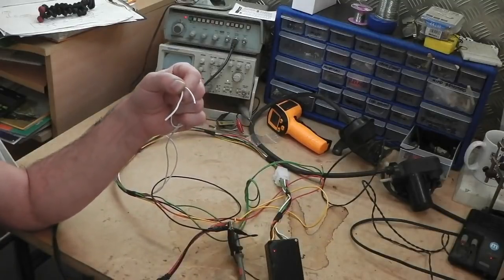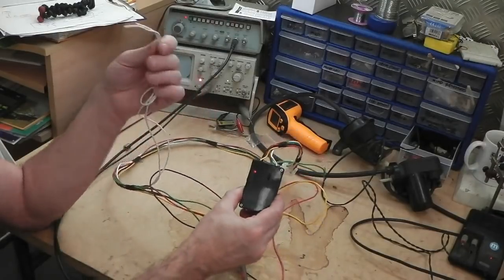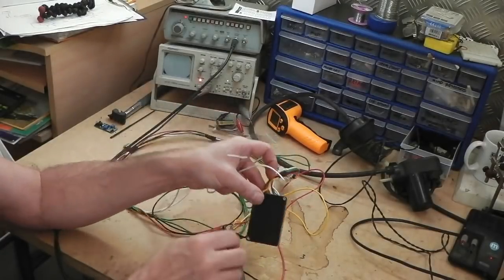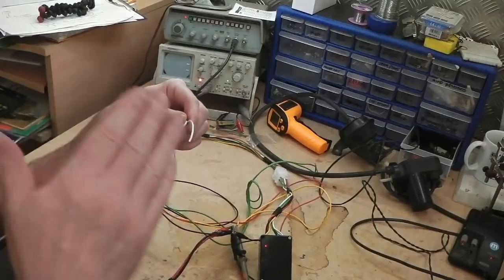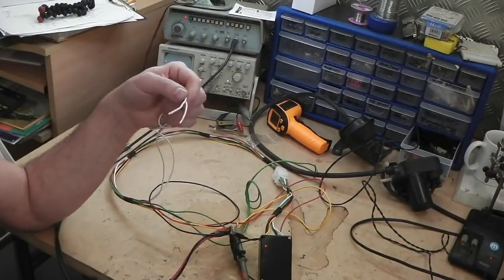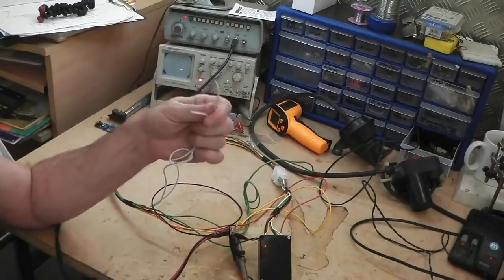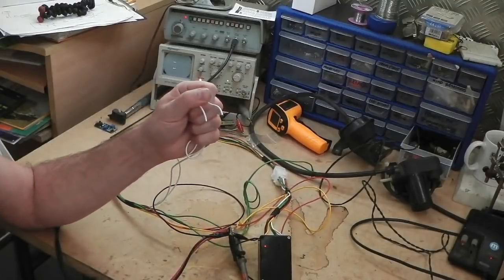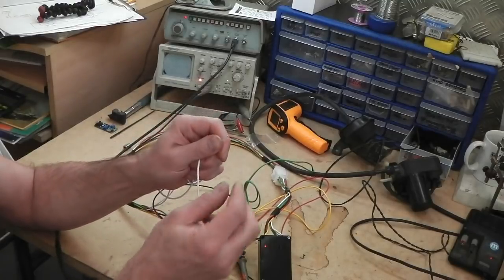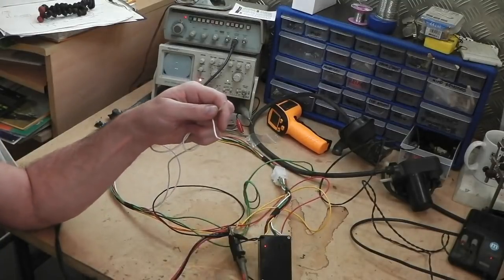if the box says yes, 12 volts out, then go to the solenoid. There's a little relay in here, but we're actually going to use it to trigger a secondary relay. This has got the relay for this, but only a very light duty one. That's called a slave relay, which is going to trigger the larger relay, which then feeds the feed to the box. So in that respect, you could have had just a single 12 output, but I did it this way for safety, okay? Because the 12 volts going into this will supply to the relay, but the same 12 volt feed will come off the main relay into the box.